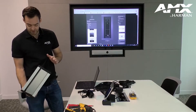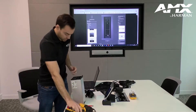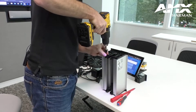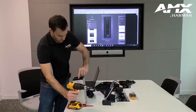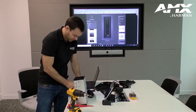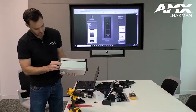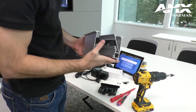The first thing is to take the sides off, which are connected via six screws. I'm using an electric screwdriver here — if you do use one, put it on the lowest torque setting. Once we've taken out all of the screws, the side will gently slide off and we're left with the middle section where we begin to slide our modules through.